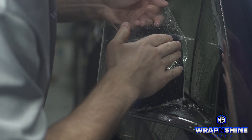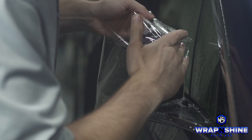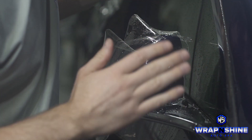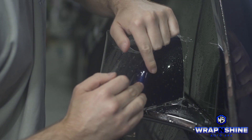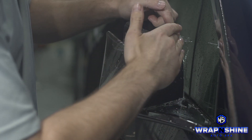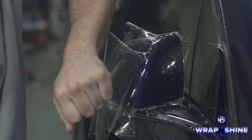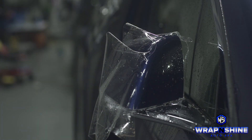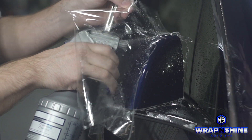The goal here is that if this is the piece I'm going to cut — I'm covered all the way on the bottom, I'm covered here — there's really no stretch anywhere. If I was to take this piece and just rip it all the way up here and cut it and not have a good seam, I might take it off and then try and get it to fit back. The problem is it's not going to fit back in this shape because you stretched it up instead of just laying it in. So for demonstration purposes, I'm going to cut and show you what I'm talking about. Always start with a nice sharp knife, and so that it doesn't move on you, spray a little bit of tack in here.